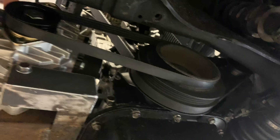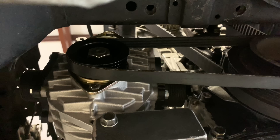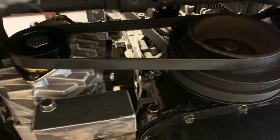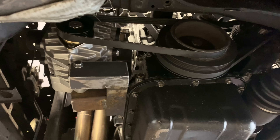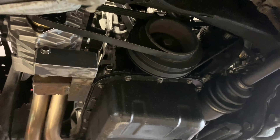So I got a belt at the parts store and this is a 27 and a half. We tried to measure it as close as we could, and there's just not enough room — when this thing tightens up there still won't be enough room to get a coupling on there. So we need the compressor to lay back just a little bit more so we can get a coupling to go in there. But it looks like that's going to work overall. We've got to adjust some holes and stuff, then get that done, and then we'll get this bracket spray painted and go pick up another belt.